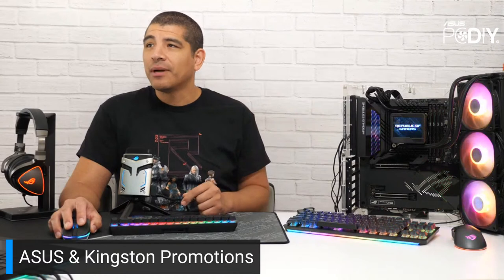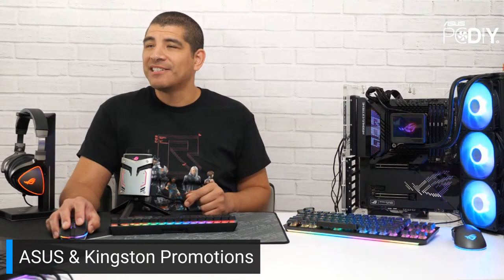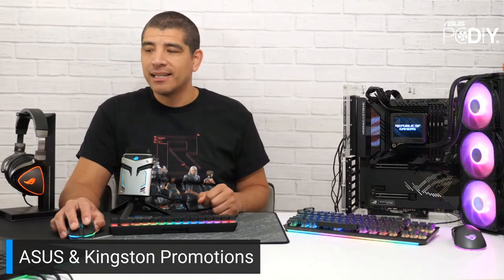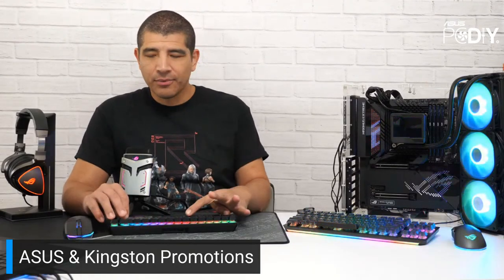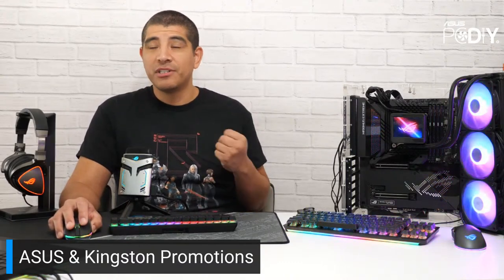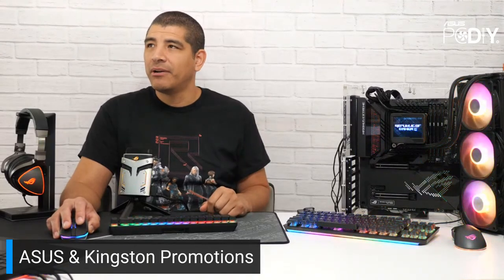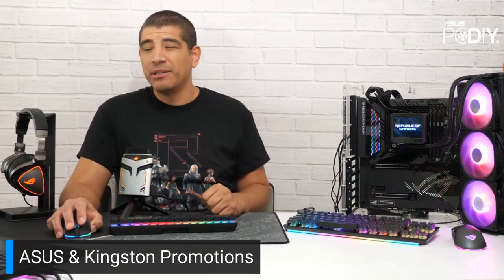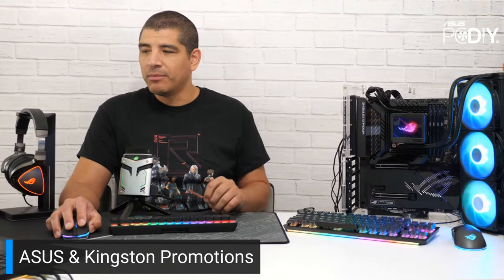While we do include the IPPC fans with our Ryujin, most users are generally going to be running their fans at somewhere between 800 to maybe about 1400 RPM at the max end, because I think that range tends to be the most reasonable. Really, anything under 1200 is quite good. Even 1400 RPM, depending on the fan design, the tone and the bearing, can still be quite reasonable. But once you start to get over 1800, it can definitely be quite a bit more noticeable, and for most people it probably wouldn't be something they would want to run continually.